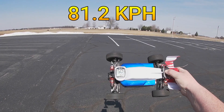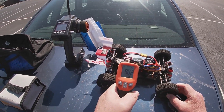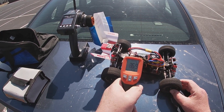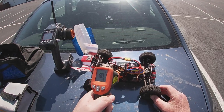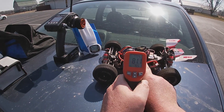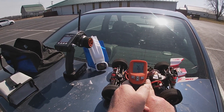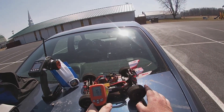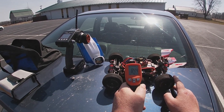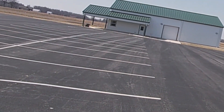We're back from the 2S passes. Getting motor readings here — got 99. It looks like about 99 degrees is going to be the hottest on that. Go ahead and check the ESC — ESC is only showing about 80. Everything is staying nice and cool on 2S. Looking at 79 on the battery, so all the temps look good on this for 2S.